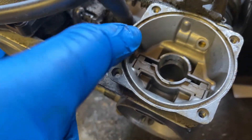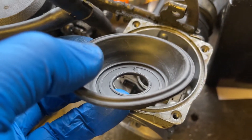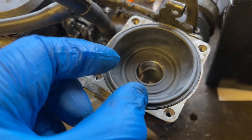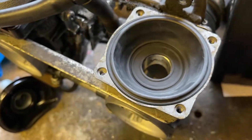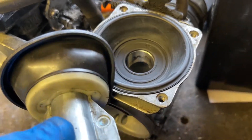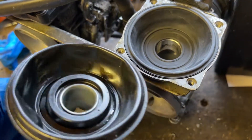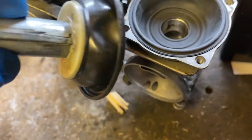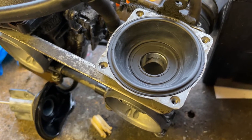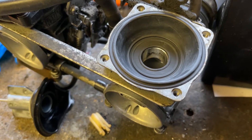Can you see that recess? I got these from Wemoto. The pair was £33 delivered, so it's not a cheap mistake that I've made by any means. And let's hope that's the only rubber that the E10 has attacked. Guys, don't run E10 on the Kawasaki ER5. Kawasaki UK recommend what bikes will take E10, and the ER5 is not on the list accredited for E10 fuels. Thanks for watching, and if you like this jibber-jabber, please think about subscribing. Thanks a lot. Speak to you soon. Bye-bye.